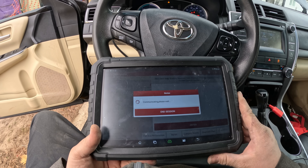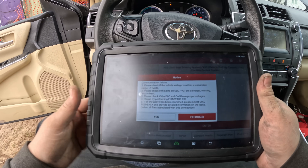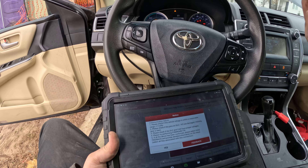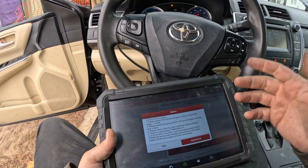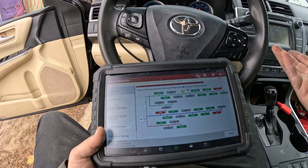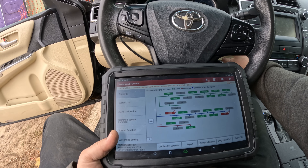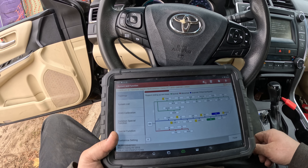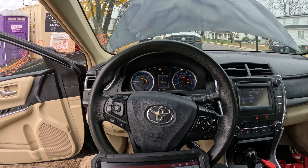Nope. I'm probably not going to have a follow-up since this is a mobile tech and it never works out for video. I'm going to tell him to replace the module — you can either buy the whole assembly from a junkyard or just swap the actual module bolted to the side. Toyotas are really good with used modules. You'll probably need to run a programming sequence like a bleed procedure, and that should take care of most of the lights besides the engine codes. I'll clear all the codes now — the ECM codes might stay cleared but everything else will come right back as soon as I recycle the ignition because it'll see no communication immediately. And yep, all the codes came back. This thing needs the module — thanks for watching.